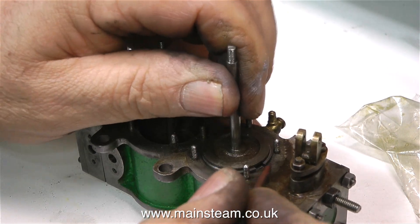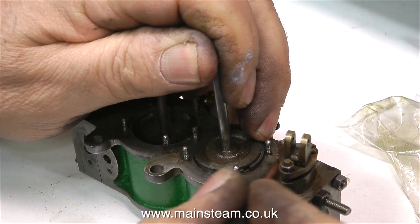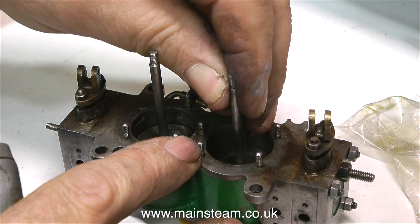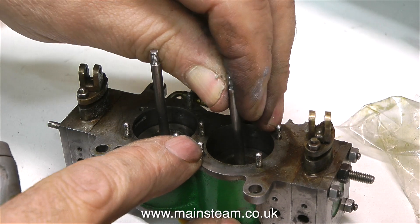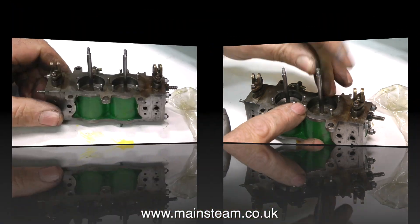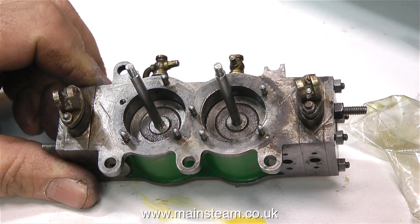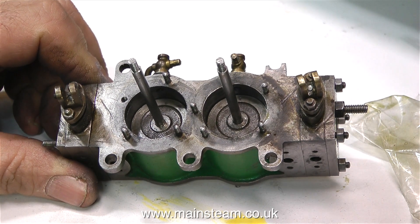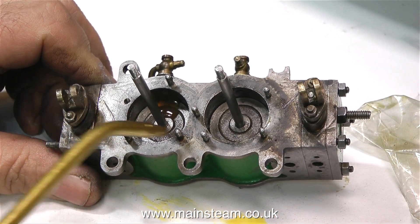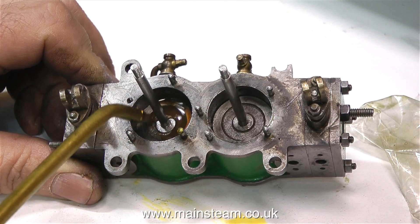As can be seen in this clip, both pistons complete with rings fit into the bore much better than they did yesterday when I tried it. I know I should be using a piston ring compressor but I don't have one, so I just use a small screwdriver. Both pistons now go into the cylinder and they feel really good with absolutely no tight spots anywhere in the travel of the piston. The actual pistons are fractionally smaller than the cylinder compared to how they were to start with, so that's a good thing. I'm going to flood the cylinder with oil to see whether any oil comes out of the other end — and the good news is it doesn't.